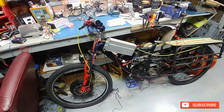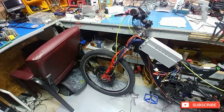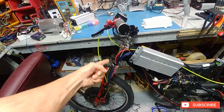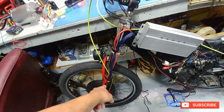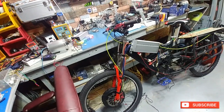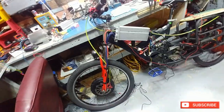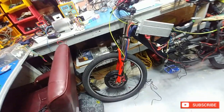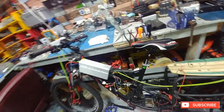Okay, so we're still on the subject of wiring. That front turned out pretty good. Now when it flexes because of the forks compressing, most of the work is going to be right here, versus before when I had the connectors there and every second ride the wiring used to break. This stuff's going to turn out pretty good, pretty solid. I might put some electrical tape just around that in case it pops off in mid-ride — that could possibly damage the controller, who knows, because of the weight of the connector itself.